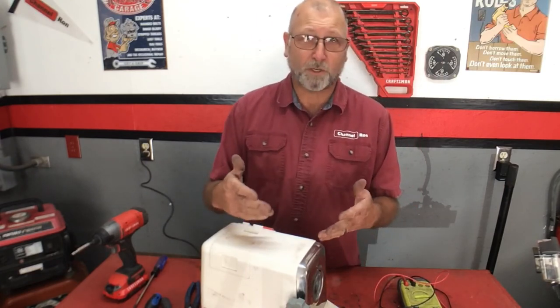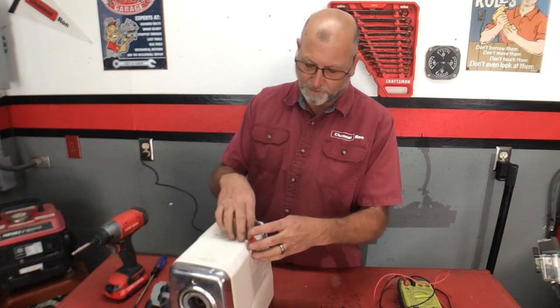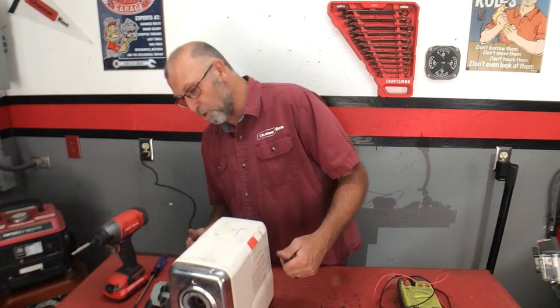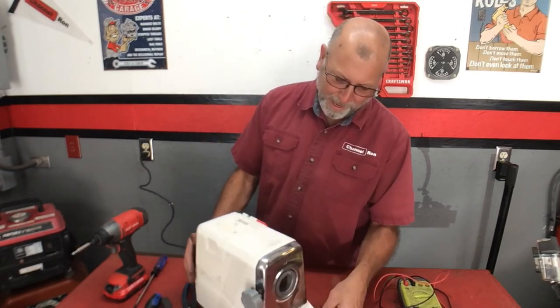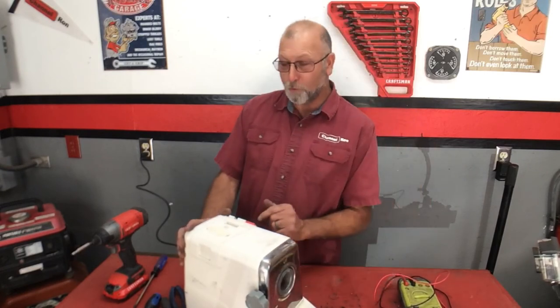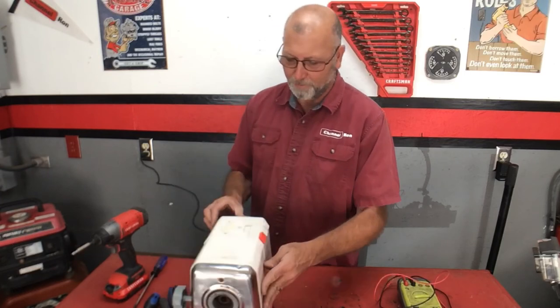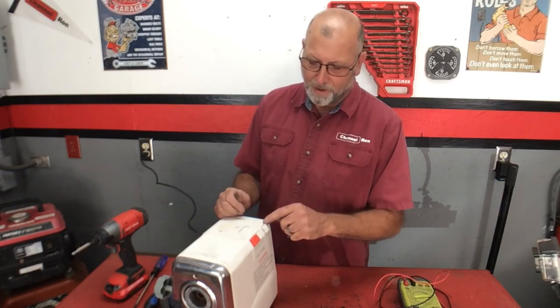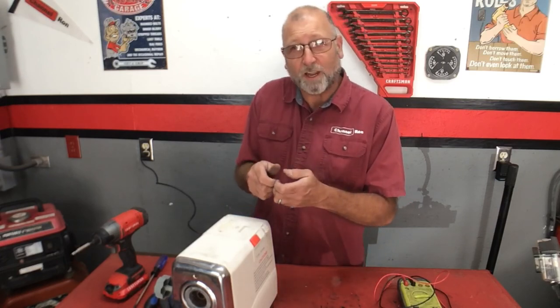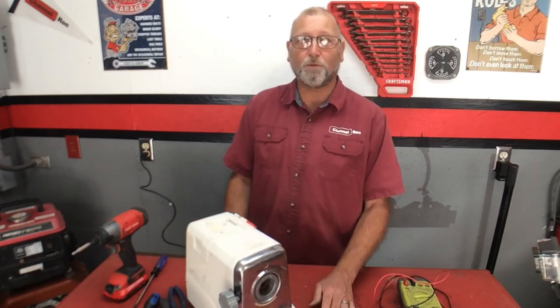As you can see, there really wasn't much to it. I'm not really impressed with the switching mechanism inside here — it must be an older model. Really don't care — they wanted it fixed, and it's fixed. I hope that helps you with your Northern Industrial Super Grinder repair. Again, it was just a circuit breaker that basically just fell out — maybe they hit it too hard, or maybe it fell, whatever the case may be. You can see I just had to squeeze that together to make it stay in there, and it should be all set for the meat grinding episode. Thanks an awful lot for watching, and we'll see you on the next one.